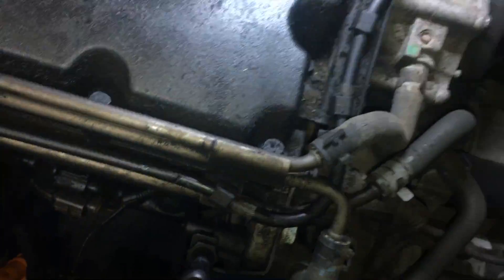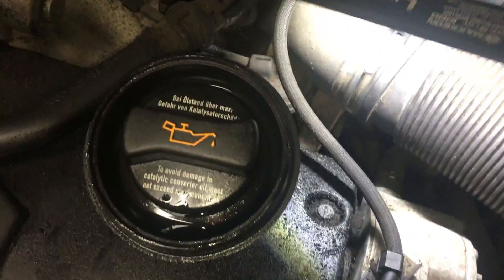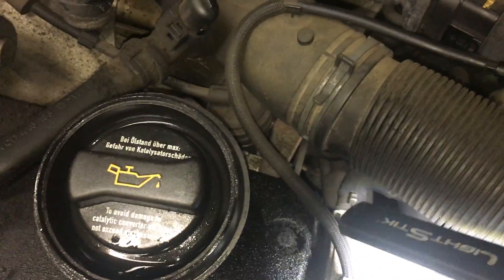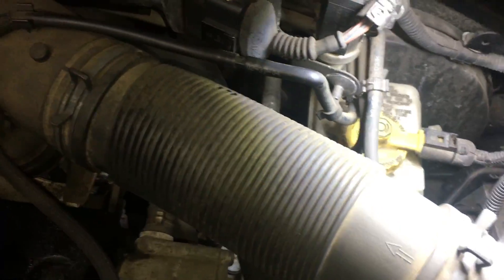Same here. You want to make sure you follow this line all the way back. You also want to make sure it's routed upward here to this notch, as opposed to somewhere downward — that will also affect how things work. So you want to check all your vacuum lines going into your boost solenoid.